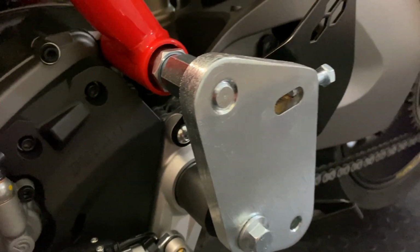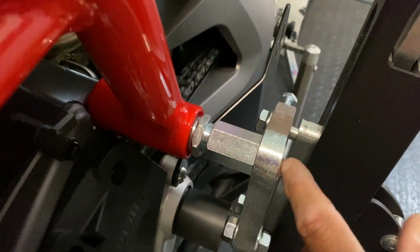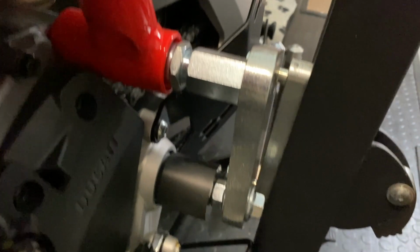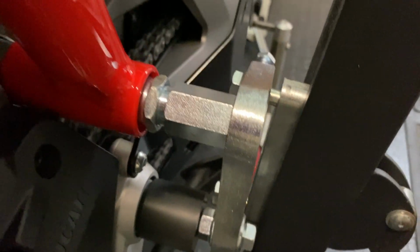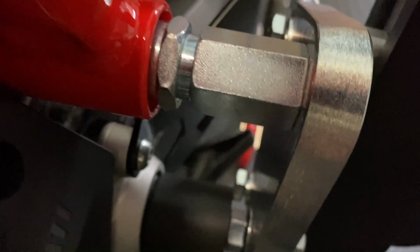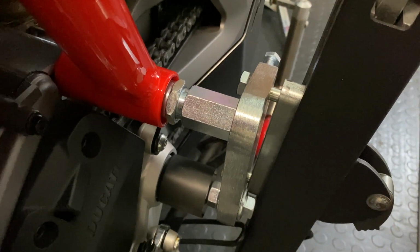Now what we're going to do is mount that up to the actual stand and see if it works. The trick is to pretty much loosely mount this up. So look, there's 2 bolts there. Slide it in. It needs a bit of wobbling and shaking and a bit of nudging and persuading. Obviously this is quite close and in the way, it's literally touching, but this is as far as this will go in, so that's fine. And then all you've got to do is, with a 17mm, tighten the 2 of them up, that one at the top, and you can obviously see that one at the bottom. 17mm, tighten them both up, and then we'll try the final lift.